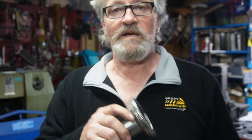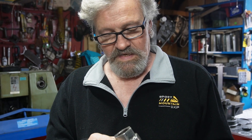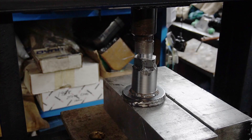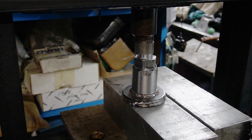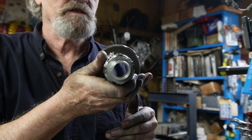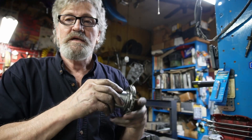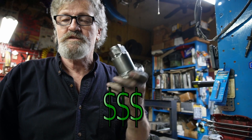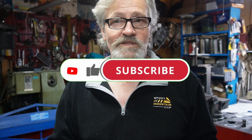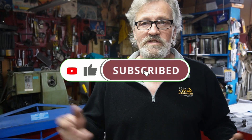It didn't take us long to make it up really, but it was kind of fun. It was great to be here with Larry, working on his bike with a friend of mine. I put a little aluminum piece in here that'll fit on the splines to keep it nice and straight when you're getting it off or torquing on it so it doesn't pull sideways. The aluminum won't harm the splines at all. So that's another little $200-some dollar tool that we're able to use. Thank you, Eleanor. Follow us along as we figure out what we're going to do with this machine and what sort of things are wrong with it as we go.